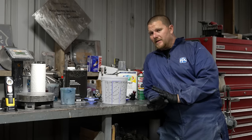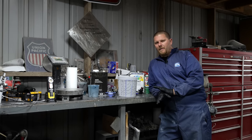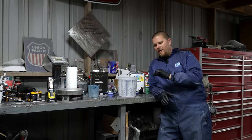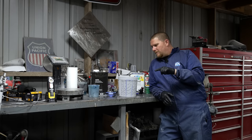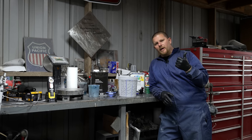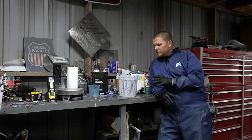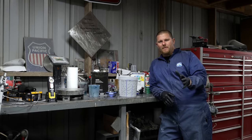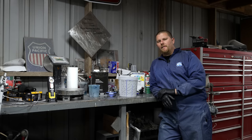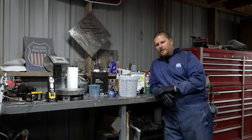Maybe you had tape lines. Tape lines is, to me, the only exception, the only time that I flow coat, is if I'm trying to knock down a separation in colors or a tape line. But what we're gonna do on this Lincoln is we're gonna do 4 coats of this clear, and really it's more equivalent to 5 coats for most, because I'm shooting out of a 1.4 tip and I paint very heavily. So we'll call it 4 to 5 coats, whatever you guys wanna call it.